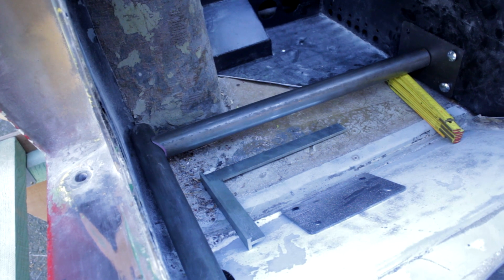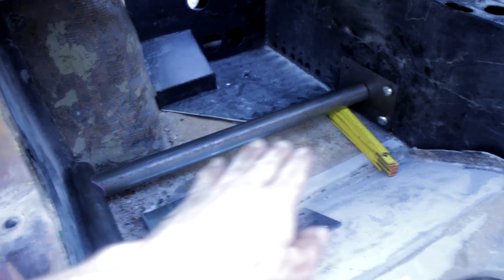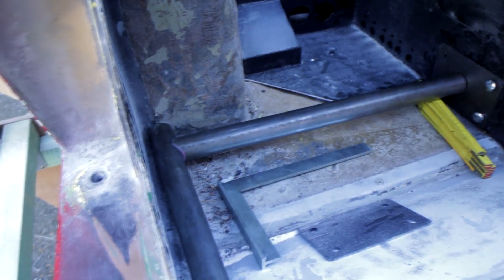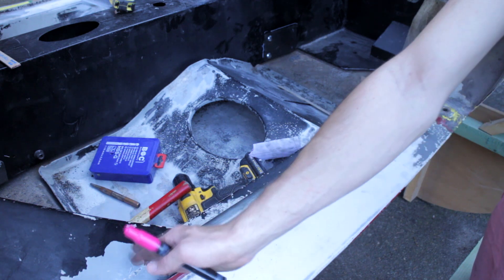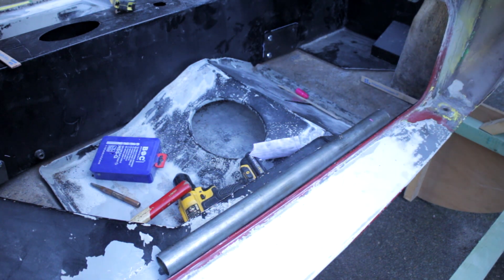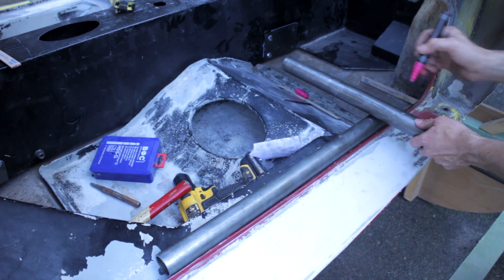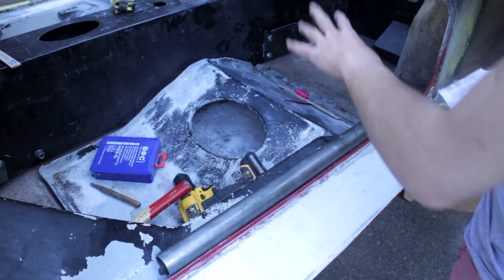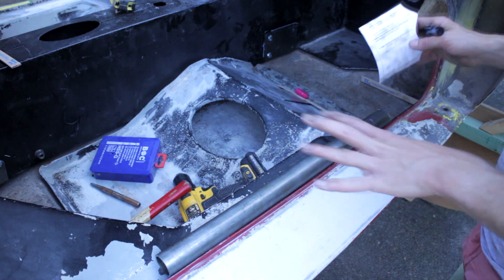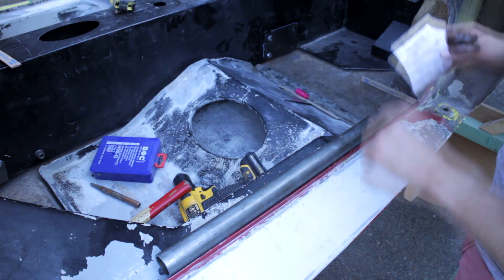I made the first of the four outriggers — it goes from the FIA spec mounting plate bolted to the chassis to the sill bar. You can see the tube has been notched. It's a little high at the moment, I want it completely level so it needs to go a little lower. I've marked the length of the tube from the mounting plate to the edge of the sill bar. Instead of trying to guess how the tube is going to sit and doing basic tricks to get the notch right — which is fiddly and needs a lot of work — I just printed out a template.